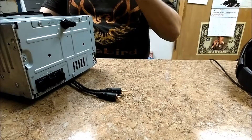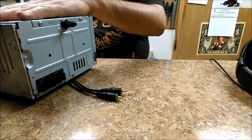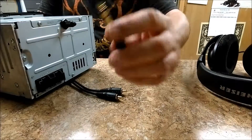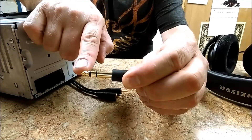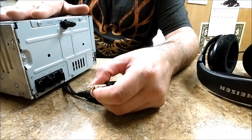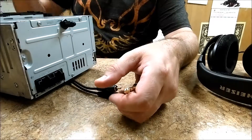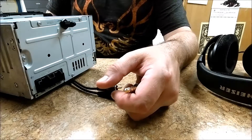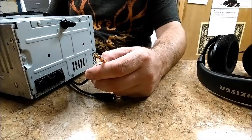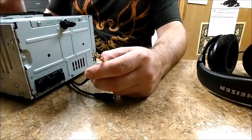What you're looking for with this test is finding the distortion level off the preamp that will feed your amplifiers from the aftermarket head unit — and that's where the headphones come in. Your headphones have a ground, a left, and a right. After you've installed the radio and got everything hooked up — power connected and RCAs dangling under the dashboard ready to run to your amplifier — turn it on. Use a good quality CD that doesn't sound overdriven. A lot of newer CDs are overdriven in their recording, which will give you a false reading, so be careful.